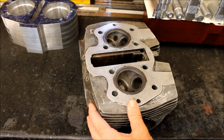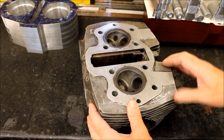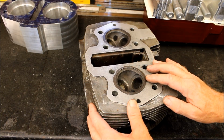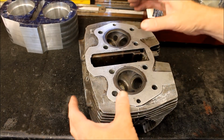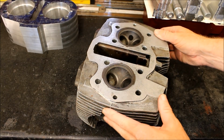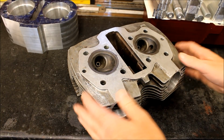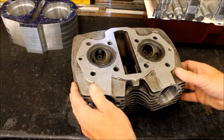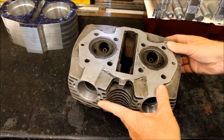If you had to try and make some and machine them in and get it all done, you're talking mega money. And is it steel, or is this a, there'll be a steel, I'm not sure what grade, but that's cast into the head when it's made. When they make the die cast, they must fit them in somehow, and that's good because it makes them very strong. So this now needs cleaning up, obviously, and what, new valve seals, is it? New valves? Well, I want to check them. I've got some stainless steel valves for them, and they all want facing up and lapping in.